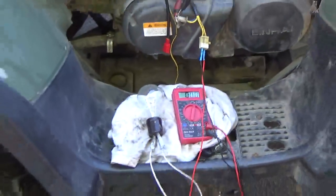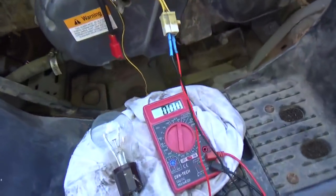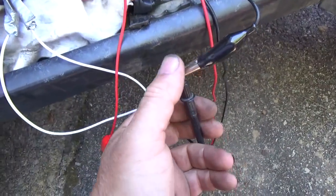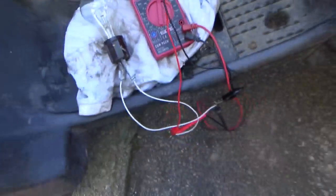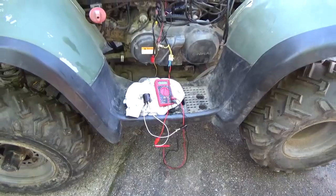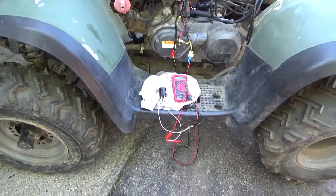Hopefully you'll be able to see that I have three phases and I had somewhere around 50 volts on each one of those phases. At one point you saw the light didn't light up, and it was because I knocked the lead off the light bulb. So the good news on this thing is my pulse generator is alive and my stator is alive.